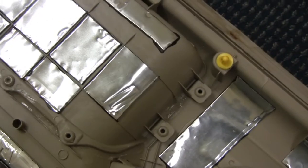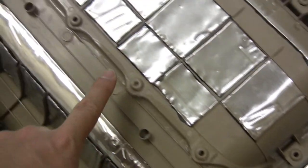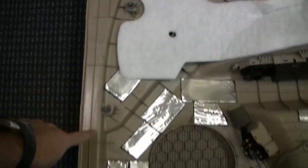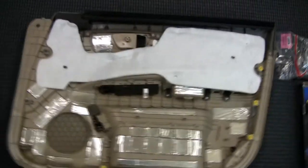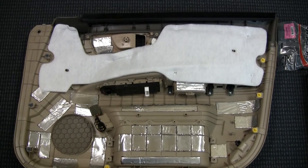The map pocket is a separate piece — it's factory-bolted on and sealed so you can't really take it off, but it's a point where there could be vibration. I've actually ran a bead of silicone along the pocket to make sure that won't be heard. Then the whole thing is going to be covered in foam. I may also get some gasket material to put along the edges — anything to just seal up the door and make it as dead as it possibly can be.